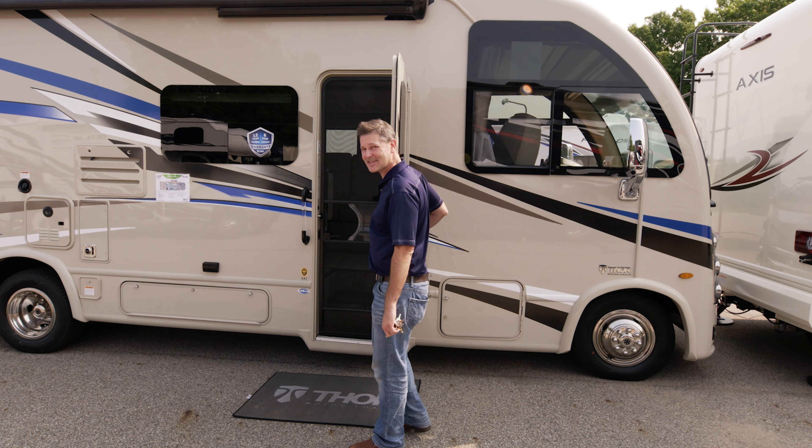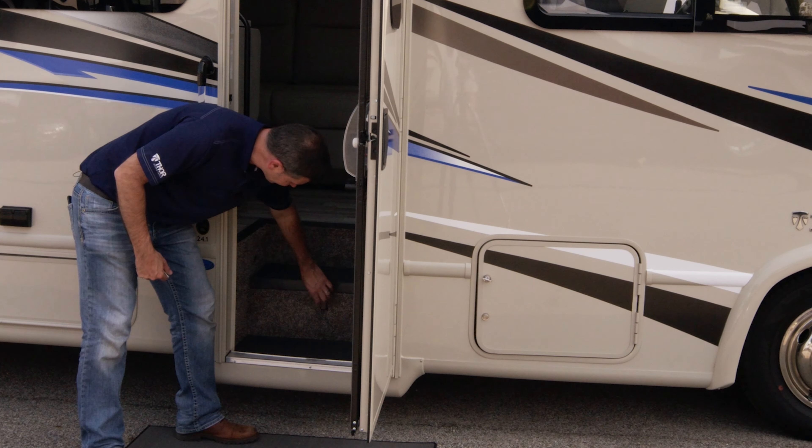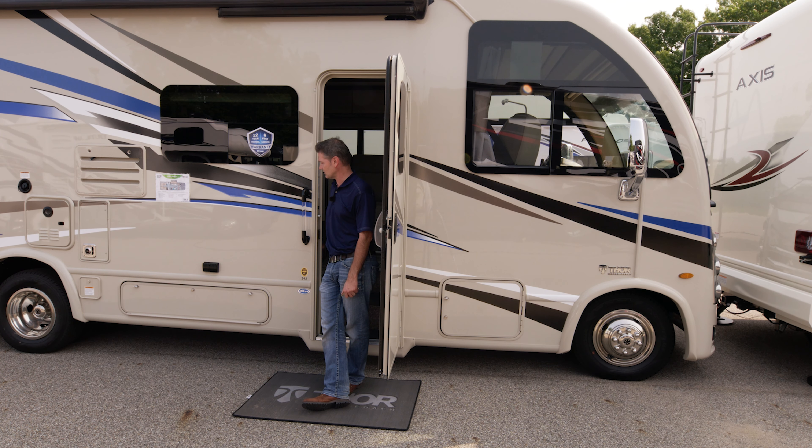Now I'm in — that's how good they work. Coming around here, there's no step that comes out right here. You can open this and you're going to find your chassis batteries. If you need to disconnect them when you winterize, that's where you would do that. The first thing you do want to do before anything else is turn on your battery disconnect switch. This is going to fire up the 12-volt power in your motorhome so you'll be able to operate your lights. Turn it on and leave it on the entire trip, because the chassis batteries are hooked up to your house batteries.